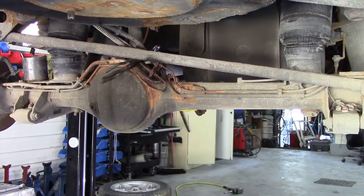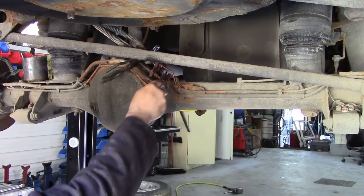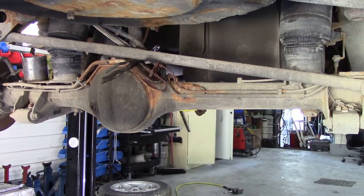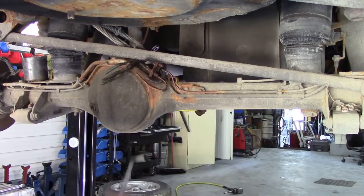These pipes here have been soaking for a little while. I've put some of my Deep Creep penetrating oil on - not named after me - and we're going to get these fittings off. Unfortunately I haven't got a 10mm or 11mm fitting wrench, only a 7/16th and it won't fit. So I've got these cutters I bought the other day from a shop, only about $7 or $12. They're diagonal cutters but they're levered, like a pair of bolt cutters. So we've got to go really close to the fitting and just snip them off like that. How nice is that? That's brilliant.